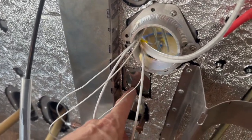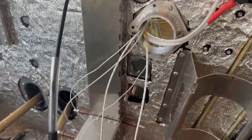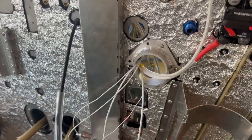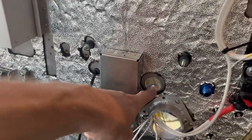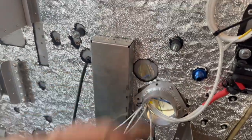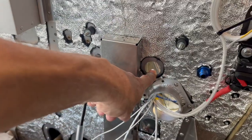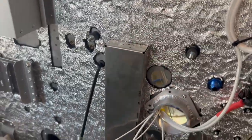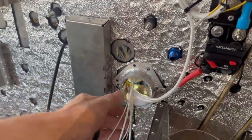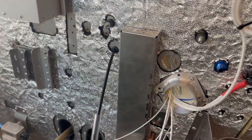The firewall comes with these holes — they look like they're still holes but they're not; they're actually filled in now with stainless. I'm not really a huge fan of having plastic going through a firewall, so I'm filling them up with stainless steel on the back and we'll probably use that space for something else. This one here is normally for coolant water to go to the heater, but since we're not having that kind — we've got a different heater — that one's probably going to get filled in as well. I'm going to take everything through here as far as electrics goes.